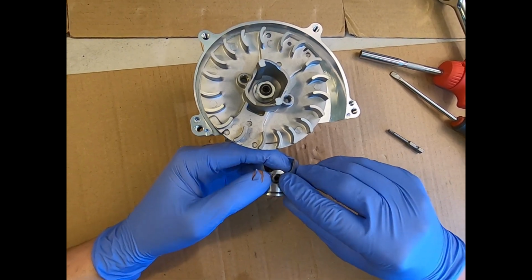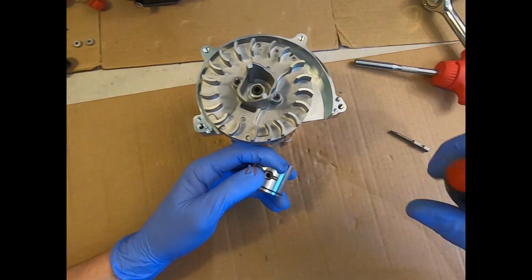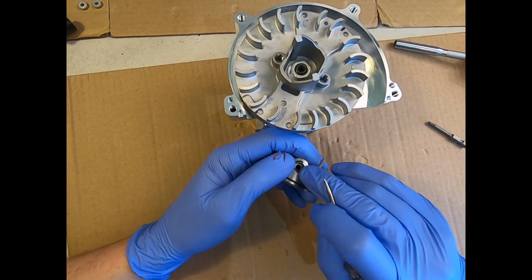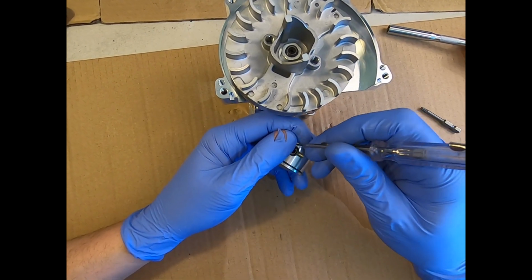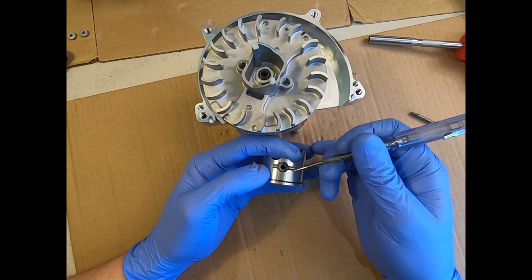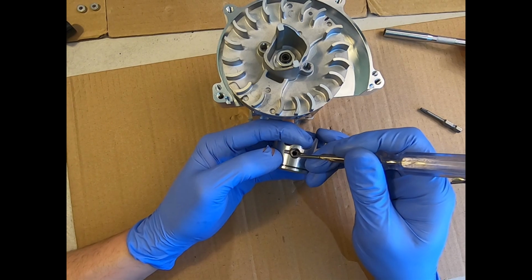So again, this is just my tactic for doing it with a screwdriver, which hopefully you guys will have available to you. I would get it lined up, and please look at this carefully, I hope it's coming out clearly. I would have it lined up just in that position, i.e. the hook of the clip has just started in the bottom half of the groove, and the other tail of the clip is sat up, just kissing that edge of the top side of the groove.